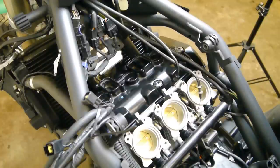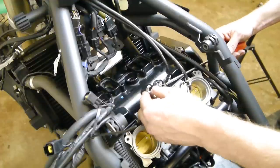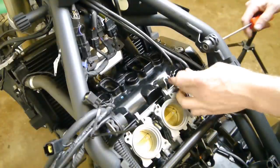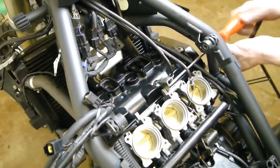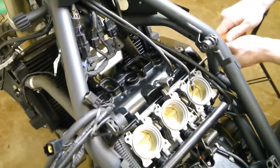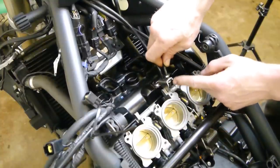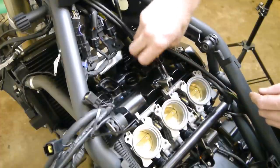Take your throttle cable bracket and hang it over the place with the screw in the bottom hole still. Put your screwdriver in to support it, get it lined up, keep it loose so you can get the top one in, then tighten those. I'm not sure of the torque — just give them a good nip. Put your throttle cables back on and tighten the top nut back down. Because you haven't moved the bottom nut or adjusted the pulley on the cables, it should be where you had it before.